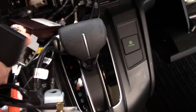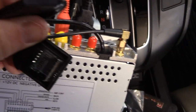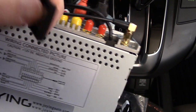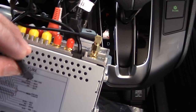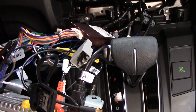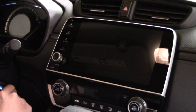That black plastic piece that sticks out is where you put the SIM card — it uses a full-size SIM card, so your nano or micro SIM from your phone won't fit. Having built-in LTE could be nice if you had a cheap dedicated car plan. I've got all USB connections made and the antenna plugged back in. Besides that, everything is ready to button up — I'll put the HVAC panel back in and we'll get it fired up to walk through it together.